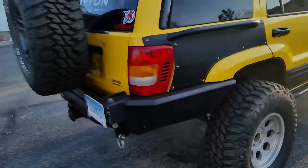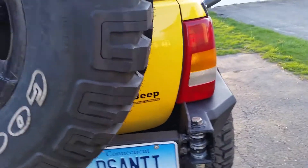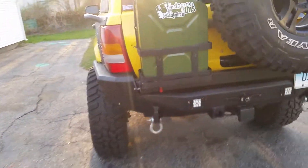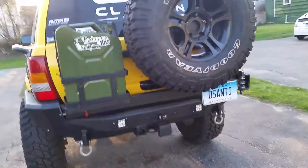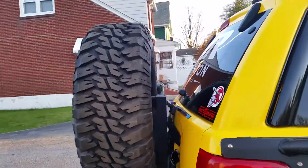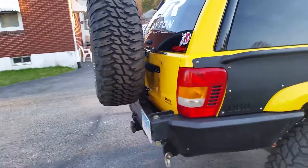Got the tire carrier back on. I shimmed it up a little bit better this time so it doesn't move as much — I had problems before with it rattling. One of the buses at my job actually rolled into it out of the garage and bent my latching pin, so I had to get that all straightened out. The carrier itself held up pretty good, oddly enough — it didn't damage it. I actually cut it at the base, notched and leaned it in some more, and re-welded it.